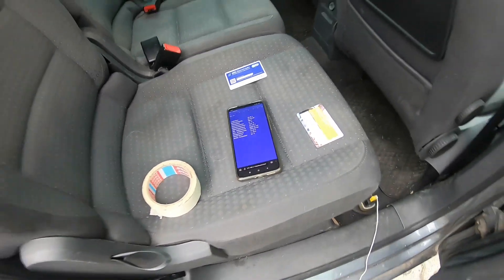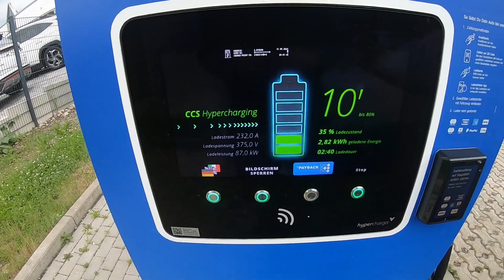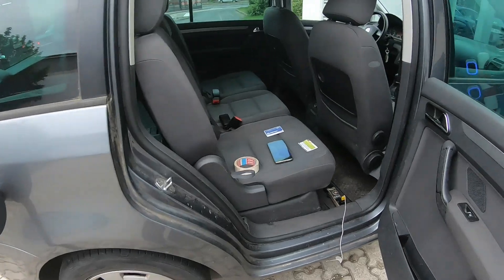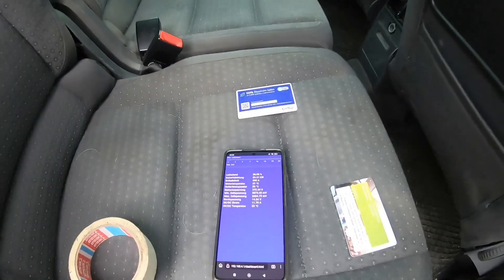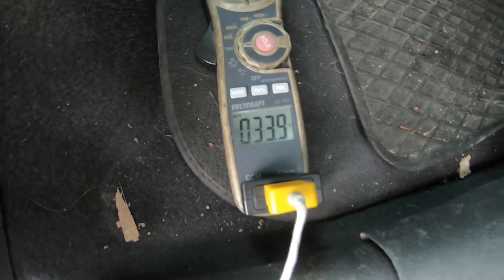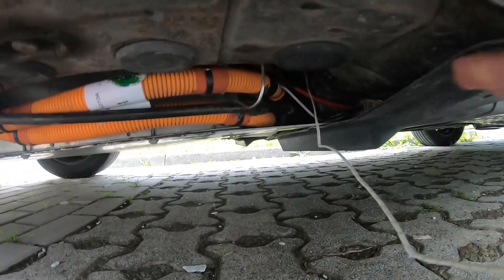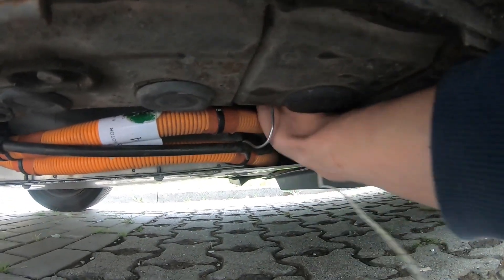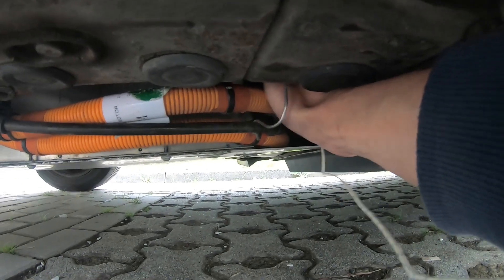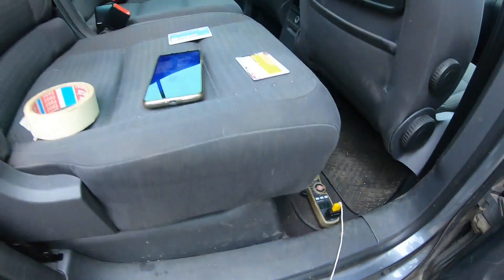85 kilowatts. We're at 232 amps, so we are reaching the 255-amp cap of the CHAdeMO protocol that I'm still running here. I'm okay with that kind of speed. The cable is at 33 degrees. With some shaky camera work I'll try to touch the charge port cables — it feels warm but not hot. The negative is slightly warmer than the positive one.